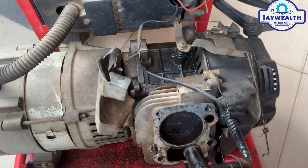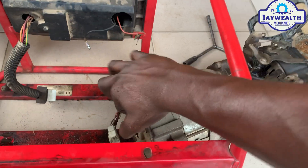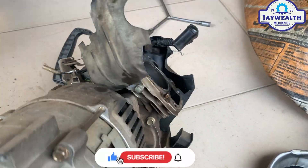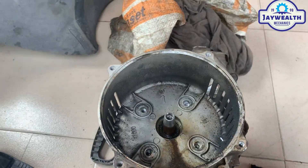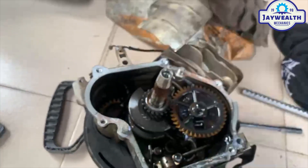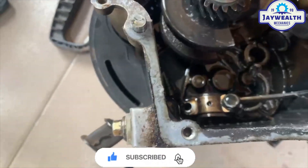If you have any questions, please kindly drop a comment below. So we disconnect the wires, we loosen the engine seat, and we remove it from the frame. If you find this video helpful, please kindly subscribe to our channel — like, share, and comment. We have to remove the coil, and the surrounding bolts we have to loosen as well. This oil seal is bad — you can see oil all over the surrounding bolts — so we have to remove the cover. Wow, this engine got knocked; you can see the connecting rod pieces inside the engine.